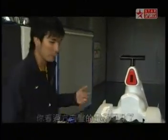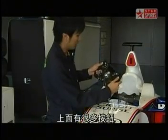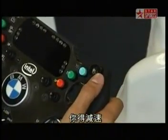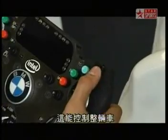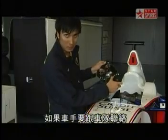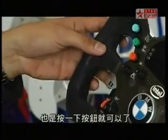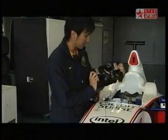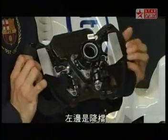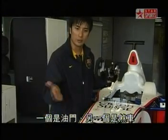You've seen the electronic side of the steering wheel, now let's look at the steering wheel itself. This is the front — lots of buttons on it. This one over here is the pit lane speed limiter; when you want to go into the pit lane you need to reduce your speed and this controls the whole thing. Over here, if you want to drop into neutral gear, it's just a button away. The driver can communicate with the team via radio, also just a button away. There's even a drink button — if the driver wants a drink, it's as simple as pressing a button. At the back, this is how you change gears: upshift on the right side and downshift on the left. These two down here are the clutches, because in the car you only have two pedals — one for acceleration and the other for brakes.